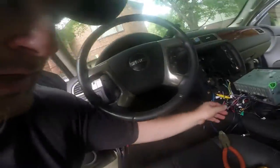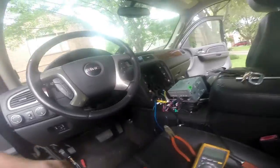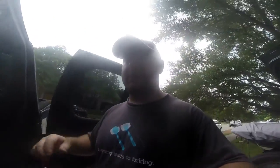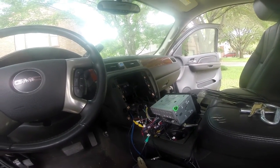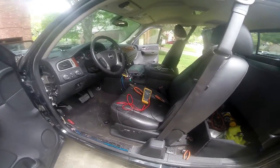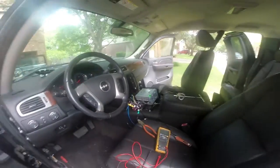Let's catch up on what we've accomplished. This blue wire is for the antenna — since it's a constant 12 volts on this truck, it's going to run to our subwoofer remote switch. I ended up having to use the backup camera that came with the unit rather than the one I bought separately, since the one I bought had a bad wire in it. The backup camera install basically just runs along the frame and in through the grommet. The actual installation is really pretty easy if you're not having to run all these wires. Everything's plugged up — I ended up using the camera dongle and the subwoofer dongle. I've played with it a little bit; the subwoofer control doesn't seem to hit very hard — it may be an equalizer thing.